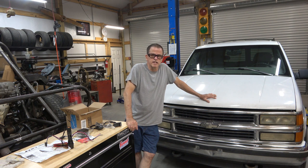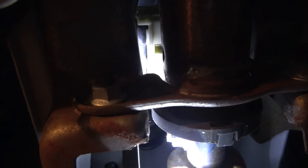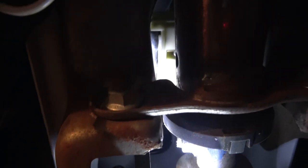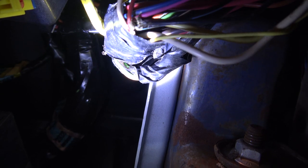Let's get straight to the wires you're gonna need to put this controller in, and then I'll show you how I did it. The first thing you need to do when you put in a brake controller is find your brake light switch. I apologize for the lighting — you can see it through this little gap right here. That plastic box is the brake light switch. The first thing you realize is you're not gonna be able to get to that brake light switch, so the wiring harness is gonna run somewhere down around. You look up color codes and find the wire you need right there.